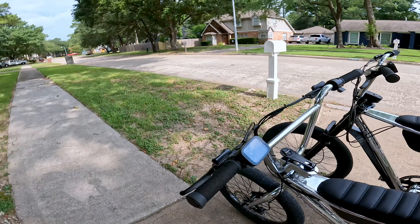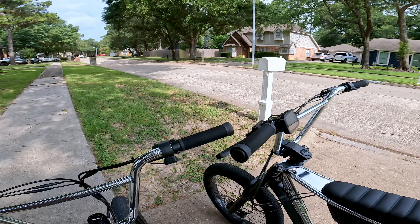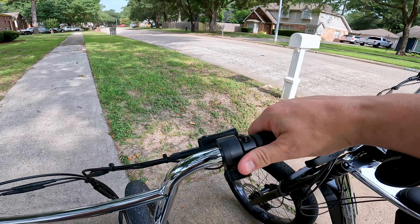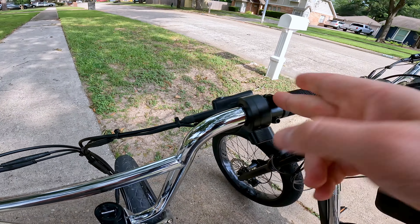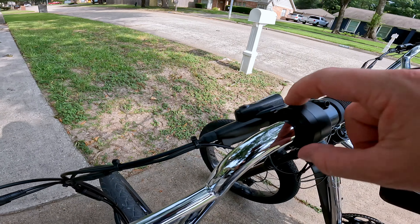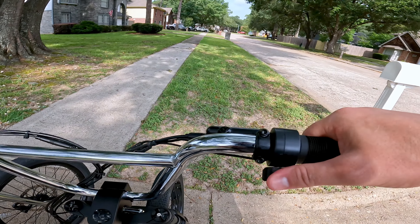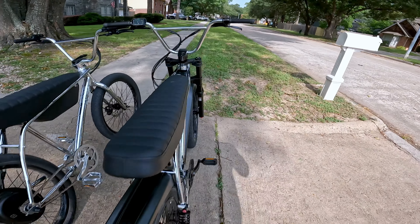These ones don't move or anything — they're on there really well — but I'll put on something with a locking mechanism and I'll be good to go. Actually you can see there's a difference between these two bikes here. On the UU 1100, the throttle is on the inside of the brake. When you're holding down the bike and you go to throttle, your thumb is going to kind of catch on that. This is an easy thing to swap out — you just unbolt it, these are double bolts, loosen it, slide it, and you don't even have to take the grips off. Super easy fix. But on the UF 1200, you can see they've already done that, so that's just a little bit better — that's the way I would set it up and they've gone ahead and done it.